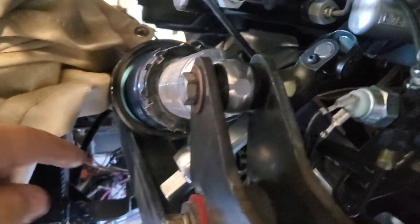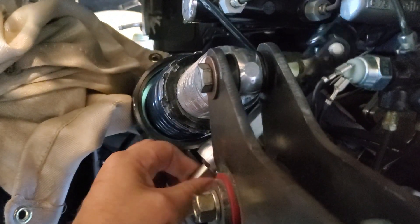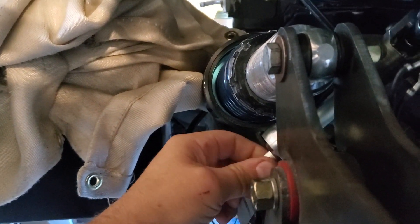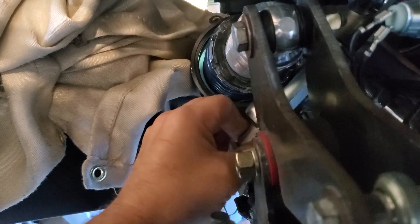Getting back to the universal joints, you can see we have one, two here, and that leads us down to here. I've taken the steering wheel off so the clock spring is not moving, because if you're moving this around willy-nilly with the clock spring engaged, you could tear or break it. I've put in two heim joints here to really pin down this collar, and I've had to make sure I had clearance with the suspension, which is really tight. This moves nice and smooth, no binding.